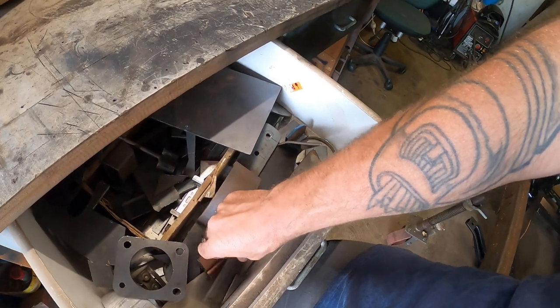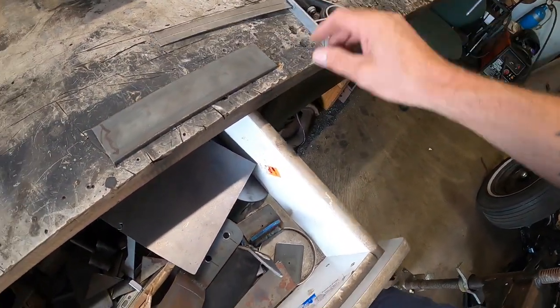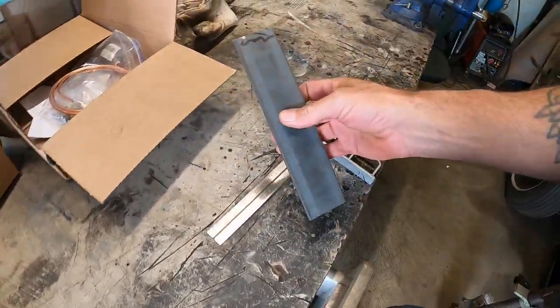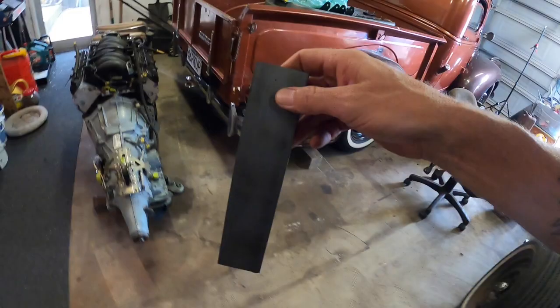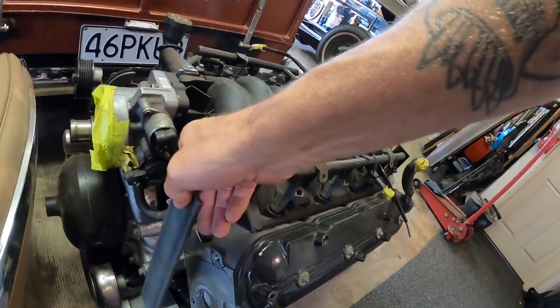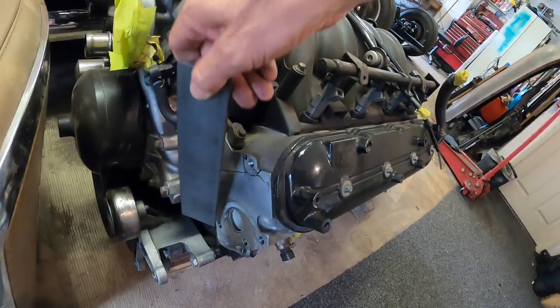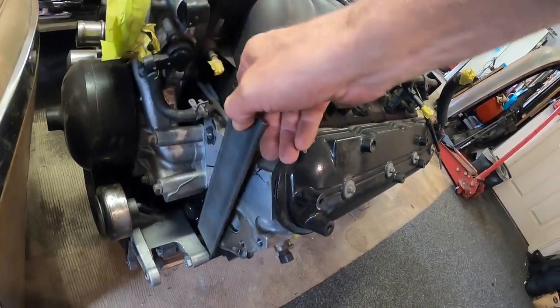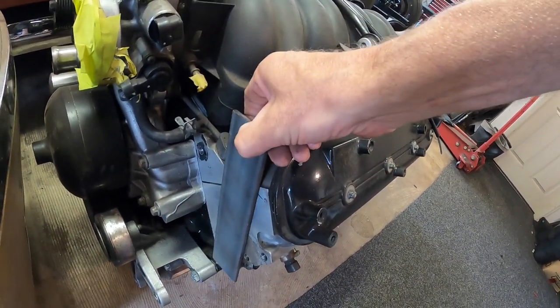Scavenging in the scrap drawer. Oh, perfect. Got a 5mm flat bar. All I have to do is drill some holes in it, and then I can use that as my lifting thingy. So if I just drill a couple of holes in there, so I can bolt it onto that top one, that bottom one, and that top one, and around there, and then just a hole at the top that I can put a shackle into, then hopefully that'll be a lifting thing.